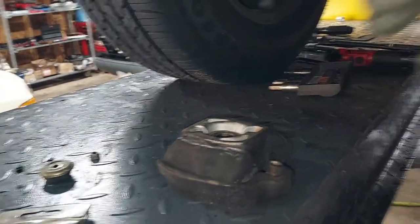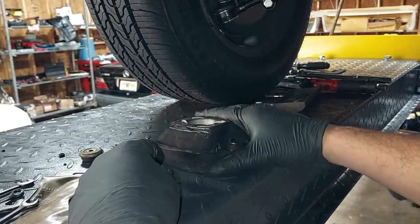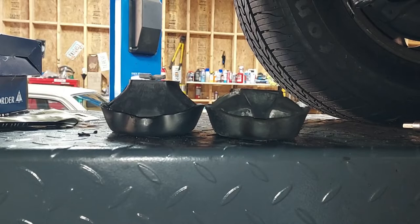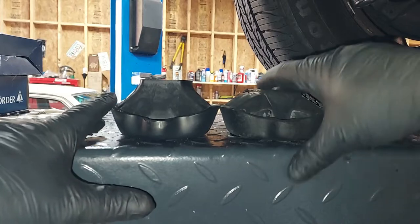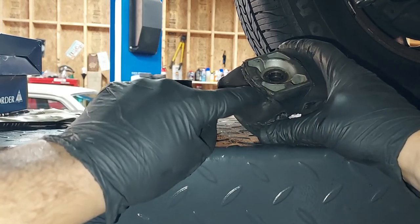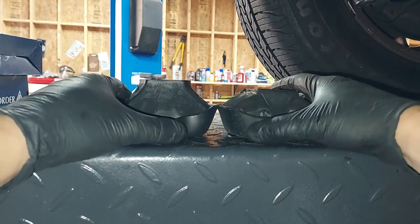This engine was shaking pretty bad, and I'm not sure if you can see, but there's a rip right there in the engine mount. So let's get some new engine mounts and let's see what the difference is between them. Okay, there's our old engine mount, there's a new engine mount. See how collapsed and compressed that is? Now this one, of course, will compress when we put it in there. It'll go down a little bit, but the little rips and stress points here were not holding it totally firm on the driver's side, and the engine was able to rock a whole lot.